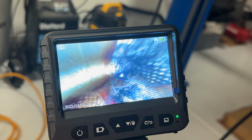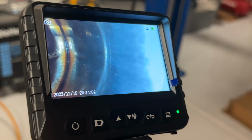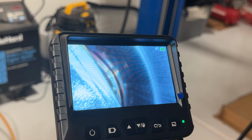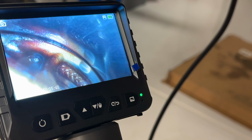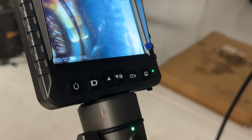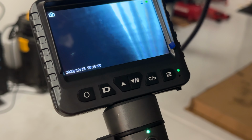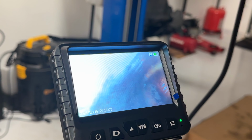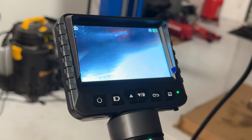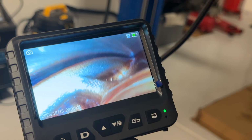Yeah, here I thought I had a little bit of an issue where there could have been some scratching on the inside, maybe some bore scoring, but I was able to get my hand up in there, see it there on the right hand side, but it was fine. And I didn't take off the caps for the bearings, but I checked everything else surrounding, and it didn't have any signs of any crankshaft damage or anything of the sort. So everything else in terms of the bottom of the piston was in good shape.